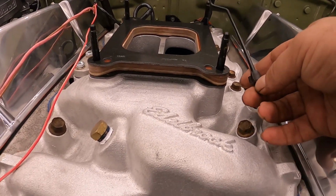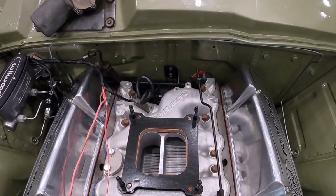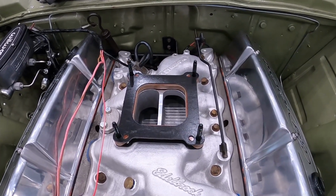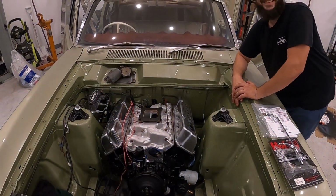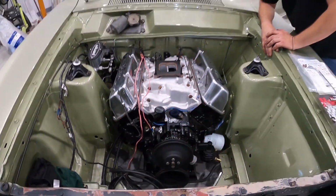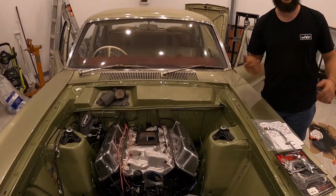I've got a few at home. When we finish this video off, I'll just quickly mention this because we're not at the stage yet: when the Carby goes on, someone's got to hop in the car and push the pedal down to the floor, and someone's got to step over the Carby before fuel's introduced, and make sure the throttle blades are opening right up, perpendicular to the throats. I can't say how many cars I've gone to where people are complaining about power and tuning issues, and me and my brother have checked it, and straight away that's the first thing, and we have to laugh. Big guys, full-on racers that we know, with full-on builds, don't check this. Guys, if the Carby doesn't open up, it doesn't matter what you've done, you can spend 15, 20 grand. The accelerator cable was so loose they weren't getting full throttle, and they said the engine's trash. The engine was the sweetest engine we ever built. We just had to sort out the throttle cable, that was it.